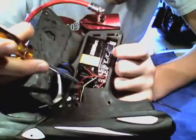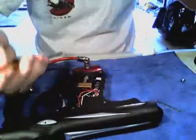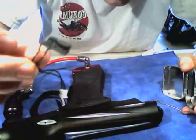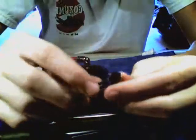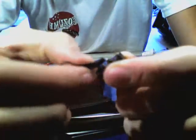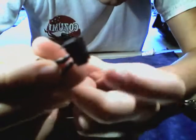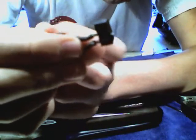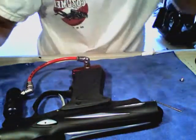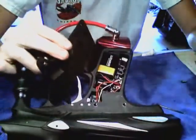Also, to swap your micro switch — take out the Tadao one and put the new one in — take these two screws out and save them because it doesn't come with another set. I decided not to put the Tadao one in. I bought a Virtue Featherlight Micro Switch for this because it does seem to shoot a little bit better. I only had the stock one in for about 3 days, and you can already see that as I hold it up, the switch is not resting on the micro controller — it's a fraction of an inch off — which I think results in a slower balls-per-second rate. I was only getting about 8 or 9 balls per second off this, which I was not happy about, so I spent the $4 on the Virtue Featherlight Switch, which is working phenomenally.